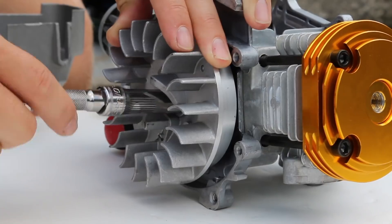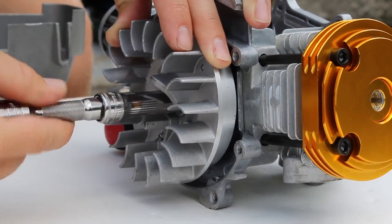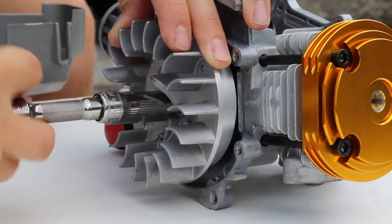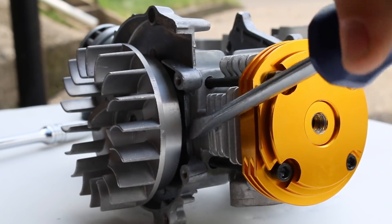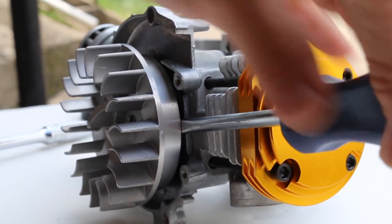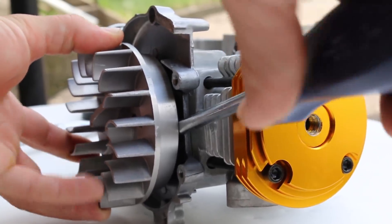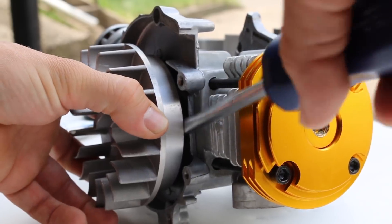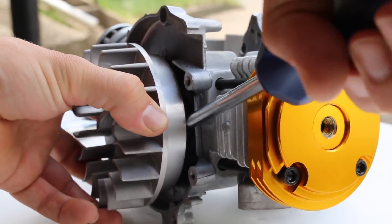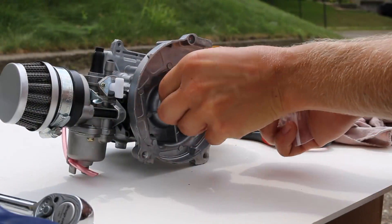Once you break it loose, pull the screwdriver out. Another way to create a jam is sticking the screwdriver in the flywheel teeth, but you risk breaking off a tooth doing that. Assuming you don't have a puller tool, just use a screwdriver to remove the flywheel by twisting back and forth and sliding it off. This doesn't take much effort — if you're having problems, squirt a tiny bit of WD-40 in the center and it should come right off. It's pretty much just pressed on lightly.